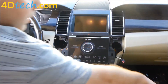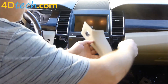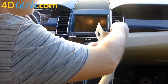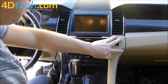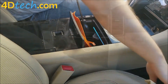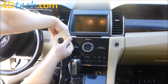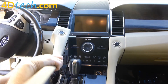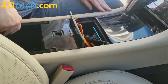With all the screws in, we simply need to replace these side strips that went down each side. On this one, make sure we plug the connector back in — plug it in until it clicks and make sure it's nice and firm. Push up here first and then work your way back. For this side, we'll re-insert the start-stop switch — as long as the wording is right side up it'll snap right in. Push it in and clip it all the way back.